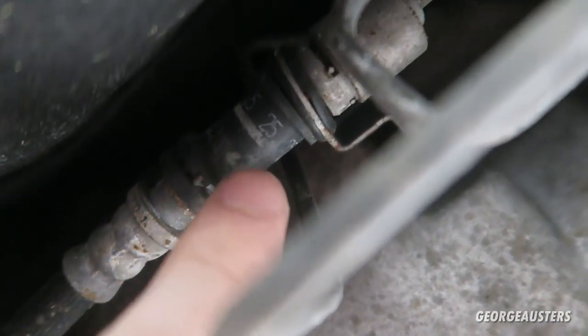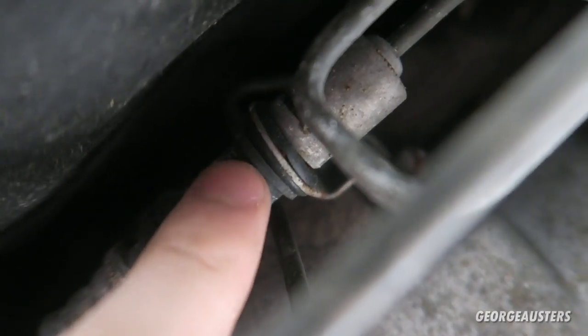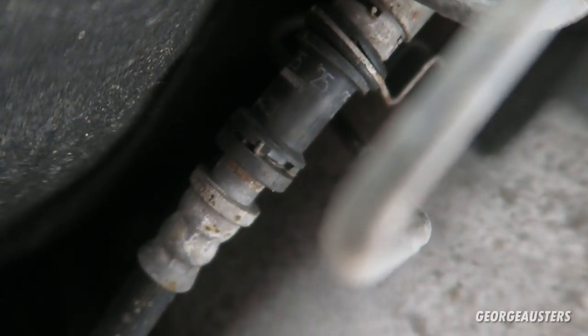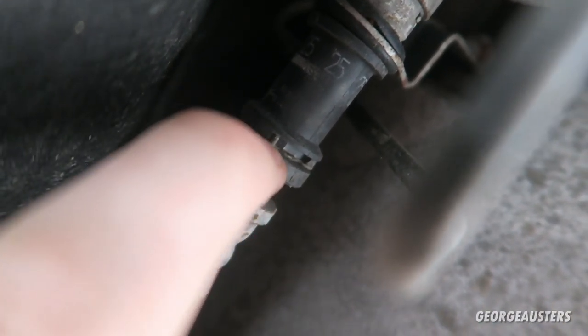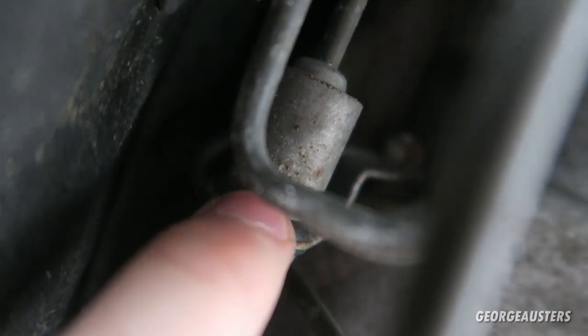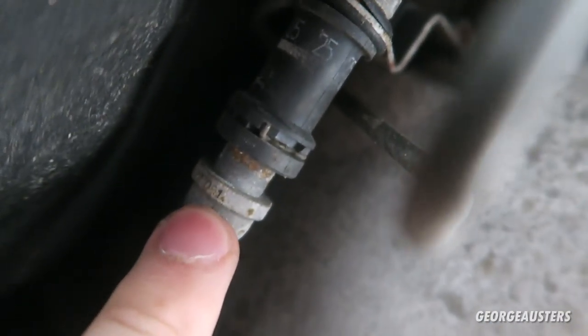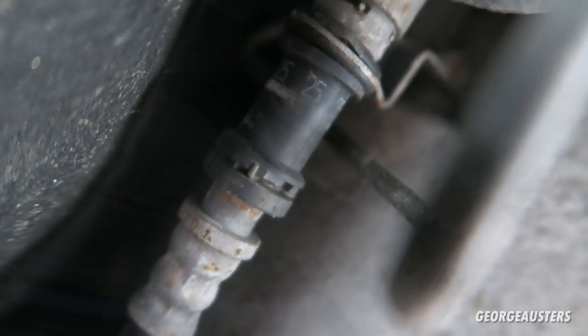Here is the transmission. If we take a look here, we have the slave cylinder, and then it goes to this thing right here - this piece of plastic. That is the clutch delay valve, and then it goes onto this hose and that goes down there and up somewhere into the engine bay. But this piece of plastic is what we need to remove. We just need to prise this clip out, and I believe prise that clip out, then remove this plastic and push the hose onto here. And that is our delete done.